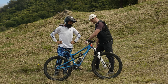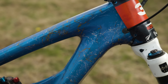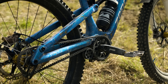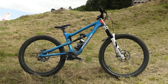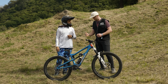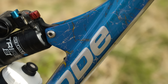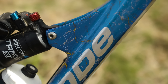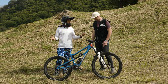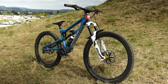And then there's this paint job — I fully did this start to finish. Stripped it down; it was that really cool tennis-ball yellow frame they had for years. Everybody loved that neon color, but I think it was time. The original non-metric shock was 216mm and metric is 230mm — the stroke is only 2mm difference, so it basically works out. Because I knew I was going to mullet the bike as well, I moved the shock mount a little bit to steepen up the seat tube a hair.